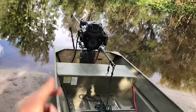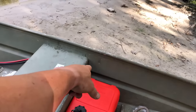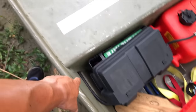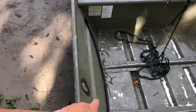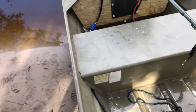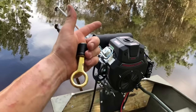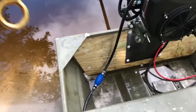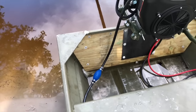I've got battery cables running along that side — I need to clean it up a little bit. I've got the fuel line coming out of the fuel pump running along this side. This is quarter-inch fuel line; you can use whatever you want. I just went with quarter-inch because the fuel filter that was on this Predator motor was a quarter-inch. So I've got a quarter-inch ball valve just in case.